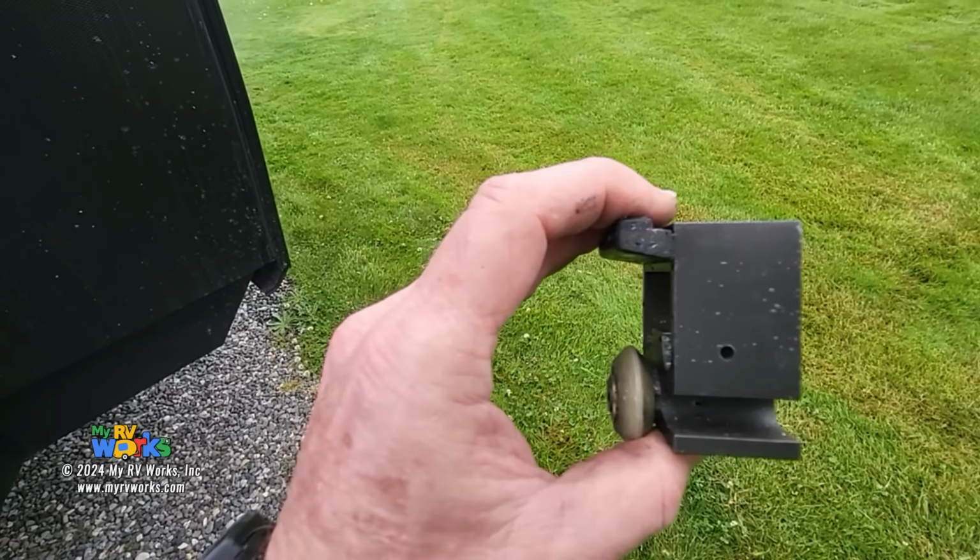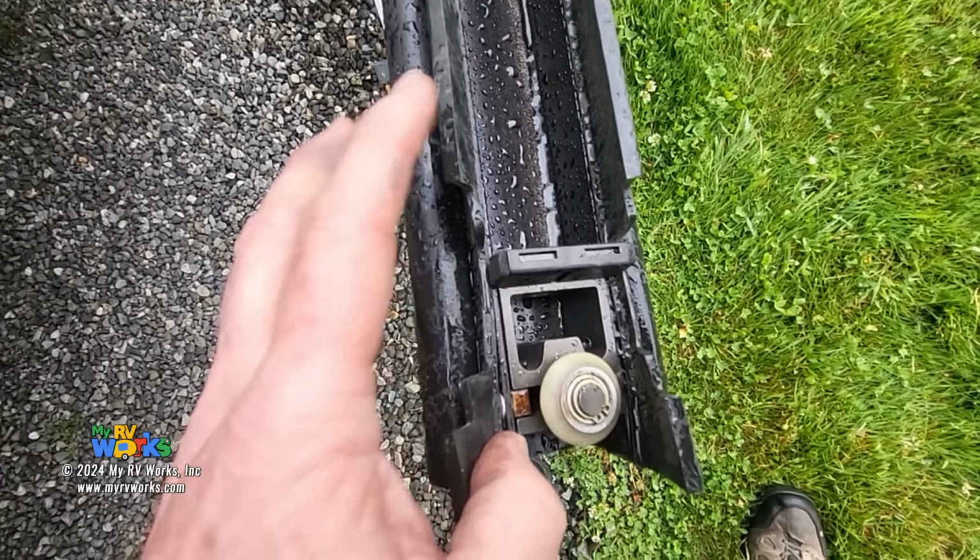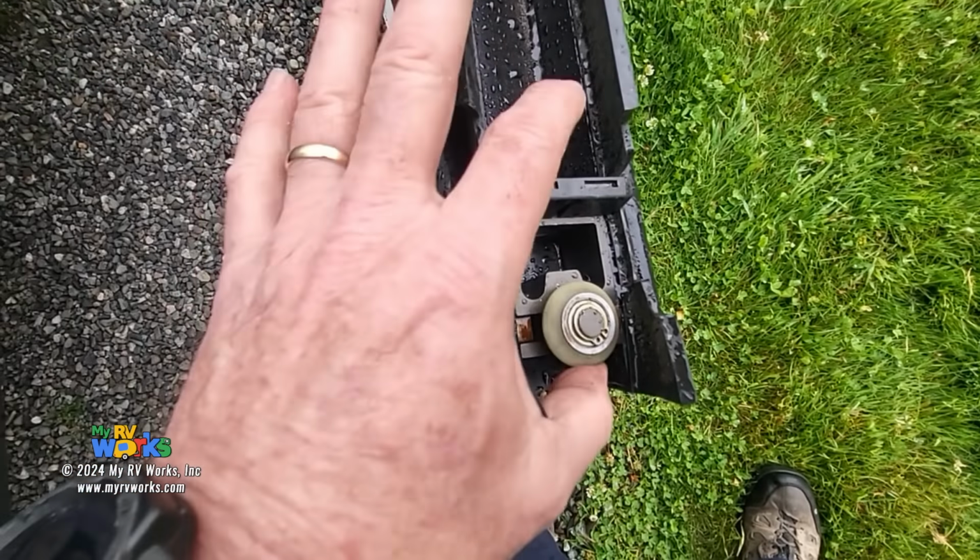Now this hole here, that's what I was fighting a minute ago. Let's go back. Yeah, there's a little bit of leftover plastic rivet right there. And maybe on this side too. Sometimes they'll put aluminum rivets on one side and plastic rivets on the other. So if you're popping your bearing blocks off, you're overcoming that little plastic or aluminum rivet. One side usually has a plastic, so the other side usually has aluminum. It's okay if they break. And so if you look on the side profile, here, it'll allow this bearing block to move just a little bit as your room's going in and out, okay?